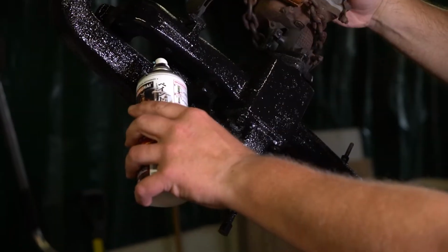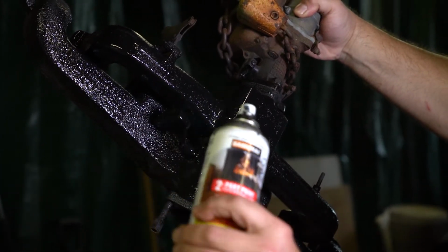The manifold is black in color. It's good to know though that this is also available in a silver color, so some may prefer that, or if you have a custom project and silver is more preferable for the project you're working on, that's available. And then when we disassemble this, we will be able to paint the manifold the appropriate color, and we'll still have the thermal protective qualities of the high heat coating under that factory color on the intake manifold. But we'll be leaving the exhaust manifold with this finish the way it is when we reassemble this vehicle.